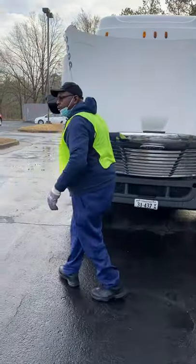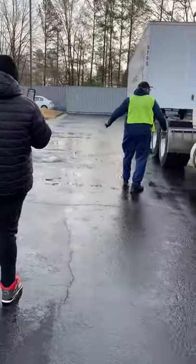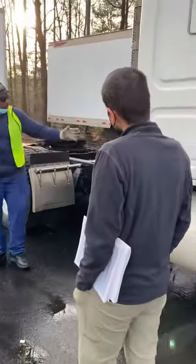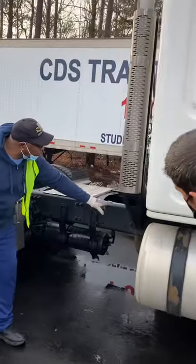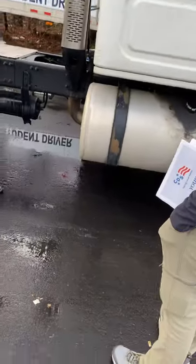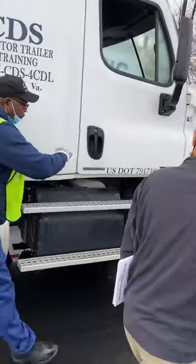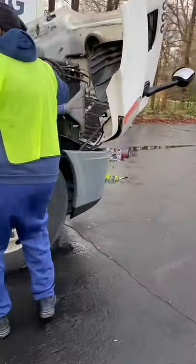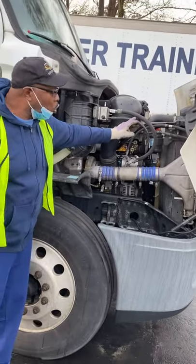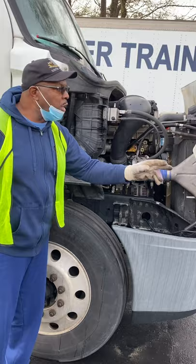I will walk back to the exhaust. This is my exhaust — it's not cracked or broken, not missing nuts, bolts, or screws. The U-clamps are in place. There is no excessive soot, which would indicate an exhaust leak. I will follow the exhaust all the way over to these hoses. These hoses are rubber — they're not cut, cracked, dry-rotted, or bulging. I see or hear no leaks.